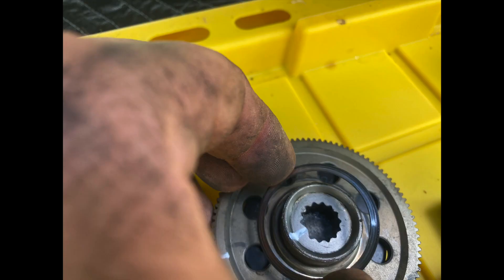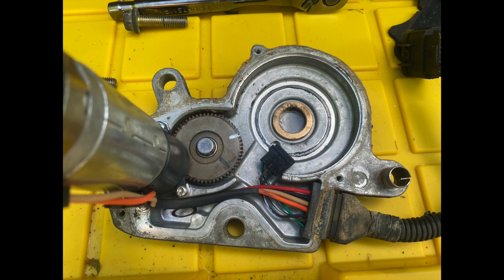Be aware that on the large gear, you may find a spacer ring like I did. Note the direction that it is sitting and remove it and set it aside. Once you have that shim removed, gently lift the gear up and pull the wiring harness off of the sensor. There are no clips on this — it is just held in with tension.